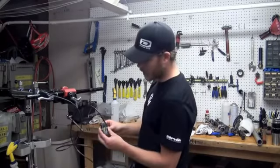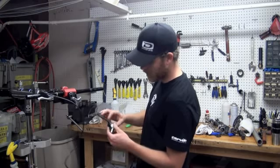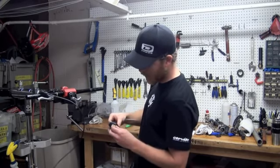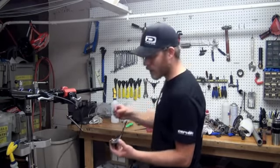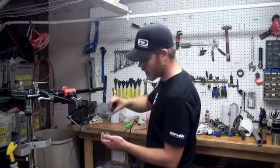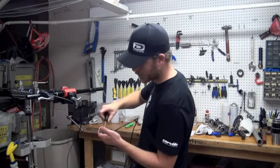You can now put the plastic pad spacer in, the bleed block. This part is important because it resets the pistons all the way back in the caliper bore and allows for the proper volume of mineral oil to go into the brake so you get the right amount of lever throw. You can hold that part back in with the pad retaining pin.